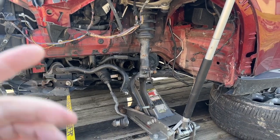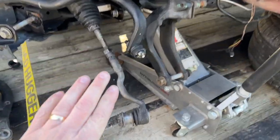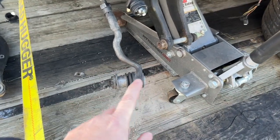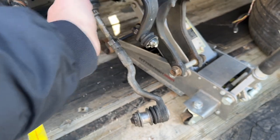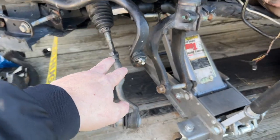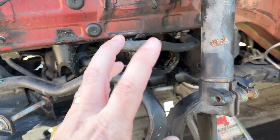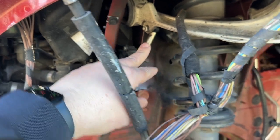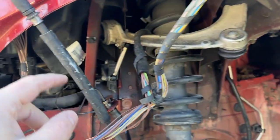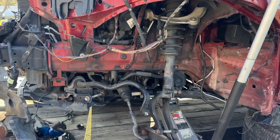Here is where we're starting today. Let me show you real quick what's left to do as far as getting out the broken parts. For starters, the tie rod end - I thought I had to replace that, bought a new one, but I think this one might be okay. I've got a replacement if I need it. I've got to get the rest of this joint out of here off of the sway bar - got a replacement, but those are going to be a little bit challenging because that'll just spin now. I've got to get the remnant of the CV axle out - hopefully it'll pop out relatively easily. And then lastly, I've got to get the upper control arm out. We've got the level sensor for the suspension here - that should be easy, two bolts either side. With those parts out, that will be the end of all the broken stuff.